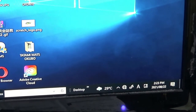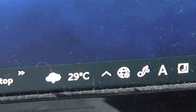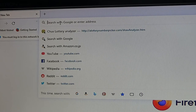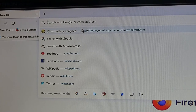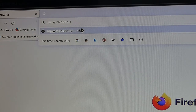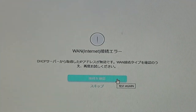I'm downstairs in my office on the first floor and I don't have internet connection yet. To set it up, open a browser — I'm going to use Firefox. Go to the URL bar and type http://192.168.1.1, or you can leave out the http://. Follow the instructions on the manual. It reads: TP-Link AX5400 Wi-Fi 6 router. Select that option.